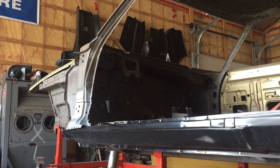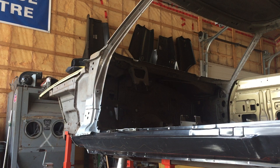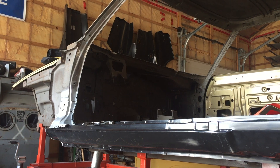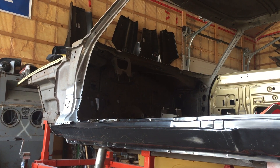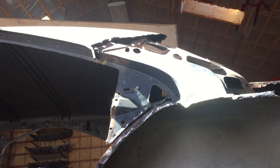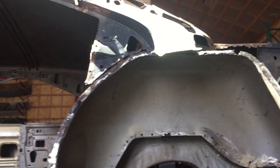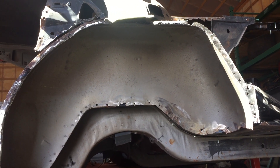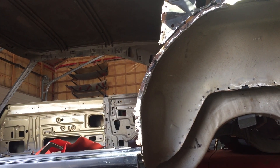They put the half panels on and because they don't fit, they put about 15 gallons of body fill in each quarter panel — just fantastic. By the time I got the car, the body fill was literally falling off in great swaths. You couldn't buy full quarter panels that go all the way up to the roof at the time, so I bought the next best thing — the ones that went up over the top of the rear quarter — cut them, and butt-welded them. But the metal was inferior.